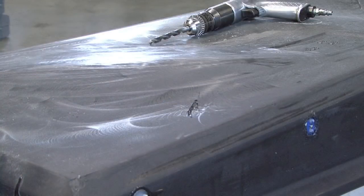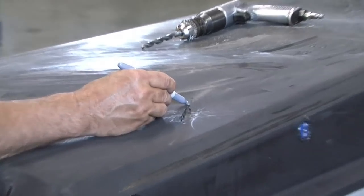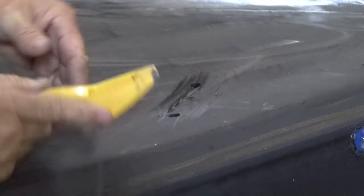To make your repair easiest, remove the tank from your trailer. When inspecting the crack, locate and mark the ends of the crack. Drill through to prevent the crack from propagating. Now clean the surface to remove any debris.